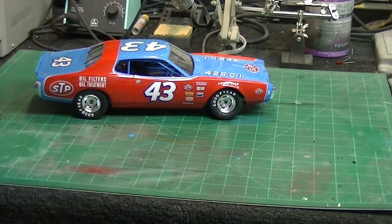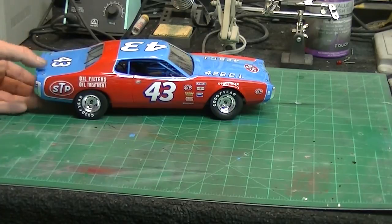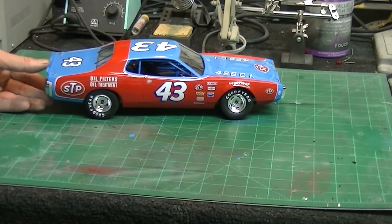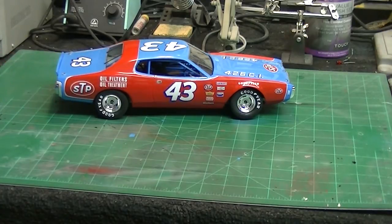So if you had it straight in the middle, you're only going to be riding on the outside edge of the wheel due to the centrifugal force trying to push it over. So they lean it a little bit more in so that when those forces occur, the tread will ride on the center part of the tire, and you'll get maximum grip out of the front tire that way, and not lose your steering ability in those high-speed turns. So I added that little detail into this, and you'll see that when those cars are sitting, they do have a tendency to be leaning like that.